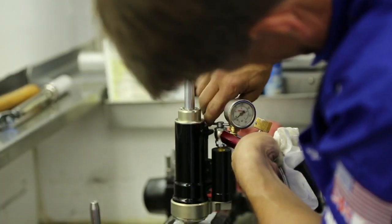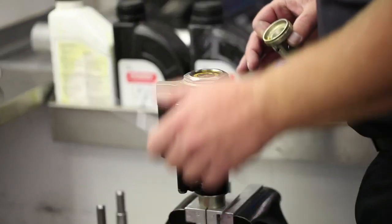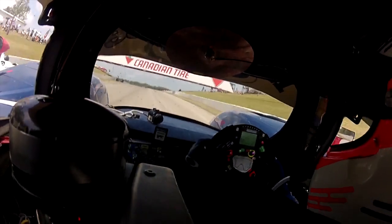Underneath that there's the damper shim stack on the piston. You can change the piston design from digressive linear, linear linear, or variable bleed. From these pistons and the shims that go on them, you can create a myriad of different damper curves. A curve starts at zero velocity, zero force — a damper is a speed-sensitive device, so the faster it moves the more force it creates. The shims vary the force at different damper velocities, letting you control what happens when the driver first turns into a corner, which is generally low speed damping, and what happens on a bumpy circuit, which is higher speed damping.